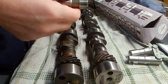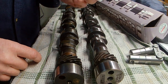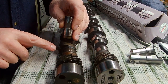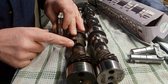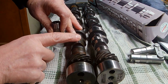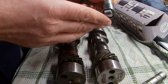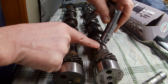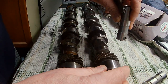The big difference between these two is profiles and the lifters that they use. The original L82 cam used a hydraulic flat tappet which rode here and it needed a nice gentle slope so that it wouldn't gall into the cam with the edge. The roller has a more broader peak because it has roller bearings, and with that extra little distance, it's able to work with the roller to run on a larger profile.